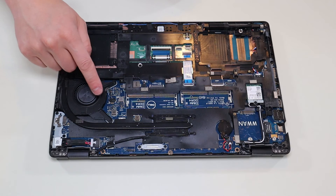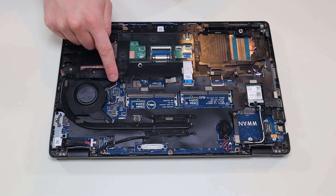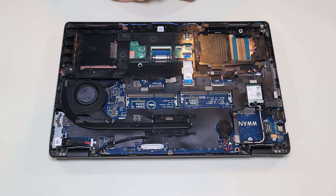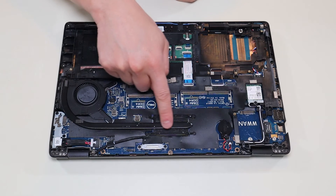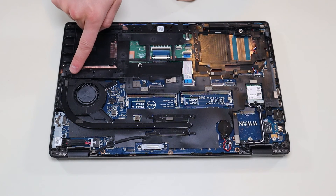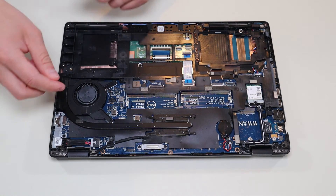This is your fan and heat sink assembly that runs from the CPU to your vent to take the heat away. There are two screws on your fan and then it unplugs — don't pull on the wires, use the two grips on either side. Once the fan is released, if you're looking to get at the heat sink assembly there are four screws above that unhook it, plus a single screw there, and you have to take the heat sink assembly out from underneath a plastic component. If you're here to reapply thermal paste, there'll be a tutorial video link above and below in the description — it was actually done on this computer.